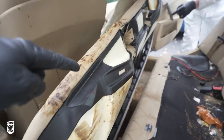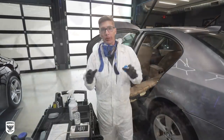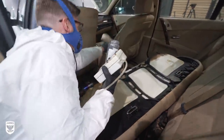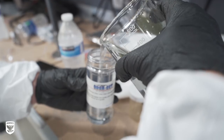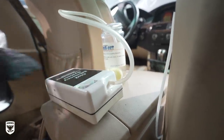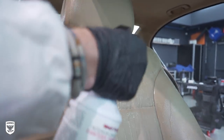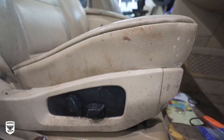So I needed to call Tom Palancia from Simonize Garage for advice once we pulled the car inside and unloaded the trunk. Step number one is to remove everything from the interior, but it's not safe for us as detailers to even get in there right now. So we're going to do a chlorine dioxide tablet treatment, which will kill off all those microorganisms. We'll fill a jar with about four ounces of water, use a tablet which once exposed to water creates chlorine dioxide gas. A chlorine dioxide efficiency system speeds up the process — without it, a couple of hours; with it, about 20 minutes. Then we'll spray a car surface sanitizer and disinfectant on any visible surface and let it sit for about 10 minutes.